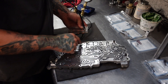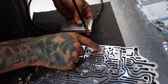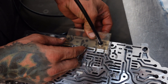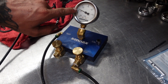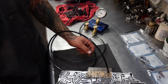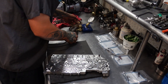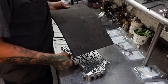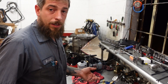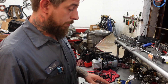Let's go over just one little area real quick. These little aluminum end plugs that we're getting ready to change — we'll vacuum test one right now. You'll notice that our vacuum is falling because it's actually leaking out of that plug on the end. So we'll change one of those just to show you guys the difference, and we'll continue on with our zip kit. If it drops more than three inches of vacuum, it's over — there's a problem. So stop, back up, time to figure out what's going on there.